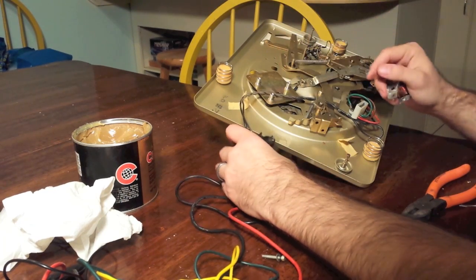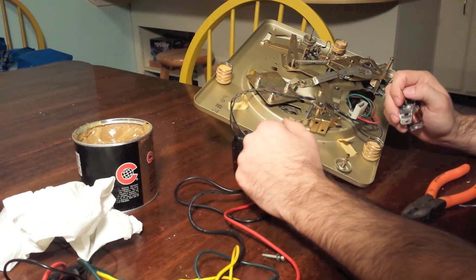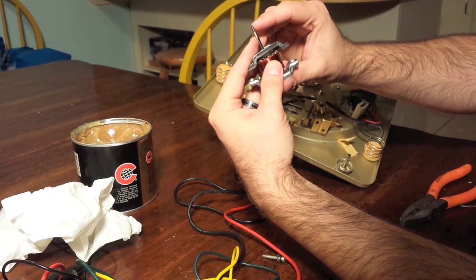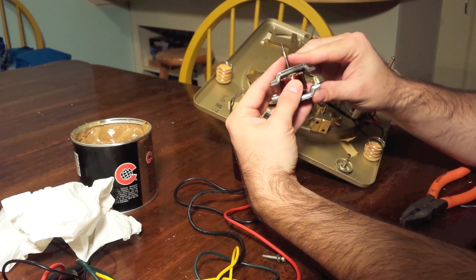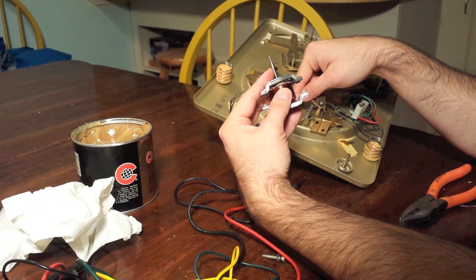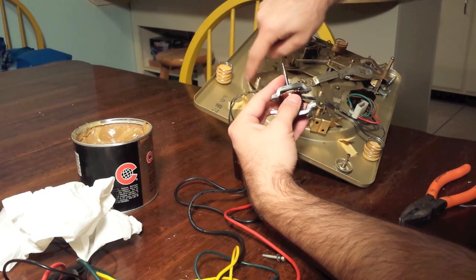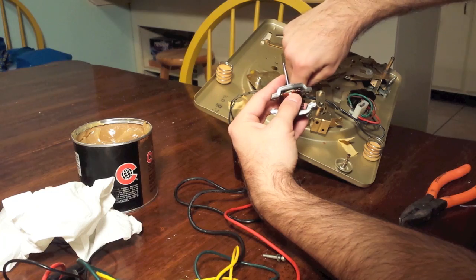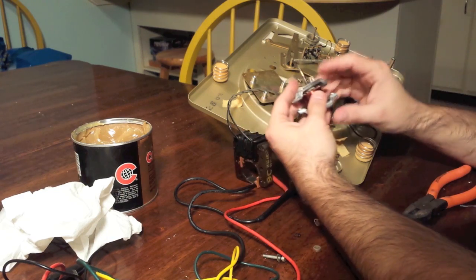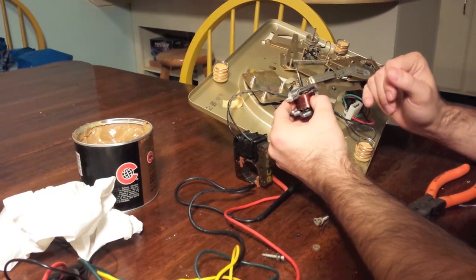On the other side is what's called an idler wheel. I'll go into more depth on this in another video, but the idler wheel goes between the step spindle here — which sets your rotational speed — and the idler wheel presses up against the inside of the platter itself. So the platter runs along here, driven by the side of the wheel, which drives the turntable. These are called idler turntables — very quiet, a little more complex, but if you know how to care for them they're quite nice.